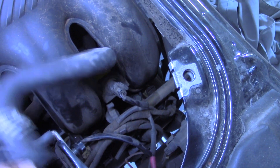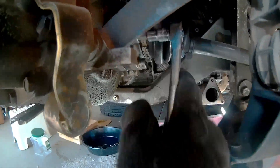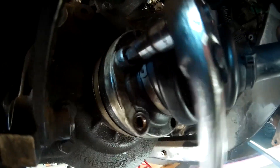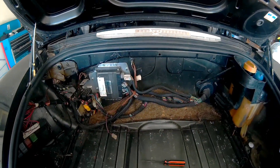The other one is the secondary air pump — it didn't really need to be removed from the car. It could have just been left in there, totally disconnected from the hose and the electrical connections. The other thing is, if I do this again, I'm going to remove the axles from the car completely and drop the engine and transmission down as one unit.